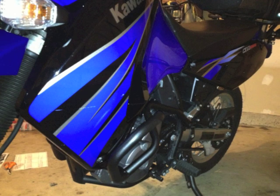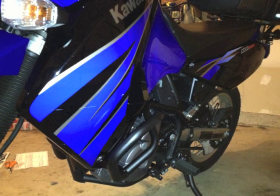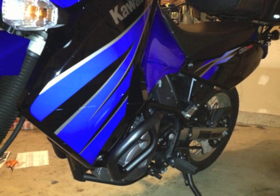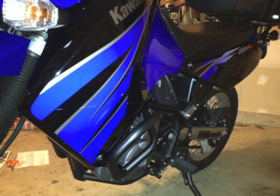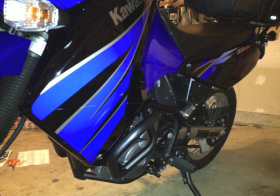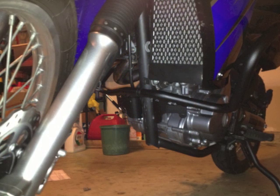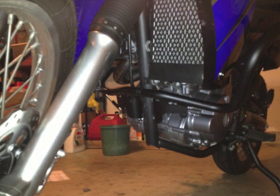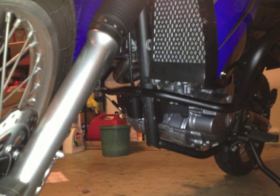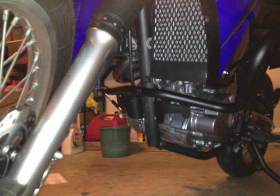Here's what it looks like — the GV engine guard is on the right side once everything has been tightened down. I did this in three, maybe four different series of tightening: loose first to get everything together, then little by little tightening each bolt around the bike. Just to show you what the center piece looks like — the two pieces that come across the front of the GV system give you strength across the sides that attach to the down tube where the engine is connected and secured to the frame.